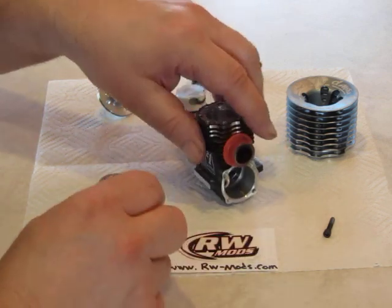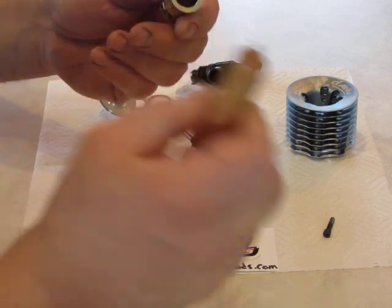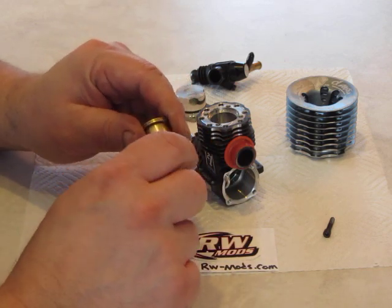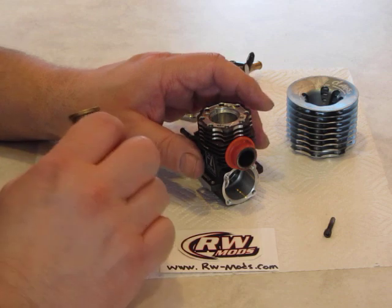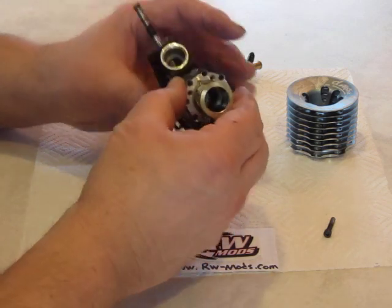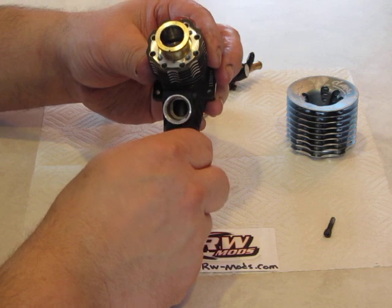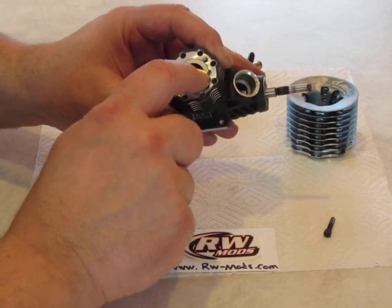Pop that on there and put some oil in the sleeve. When I clean the piston sleeve I just spray it with WD-40, blow it off with an air hose, and wipe it with rags. The only thing to be careful about with WD-40 is if the crank has been epoxy-ramped or siliconed — sometimes WD-40 will eat that. Line up your alignment and drop it down in there. Sometimes you have to rock the piston back and forth a couple of times to seat it in the sleeve. Make sure you're lined up.